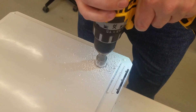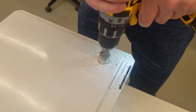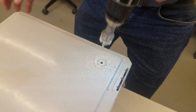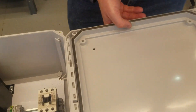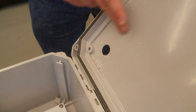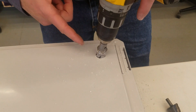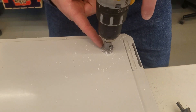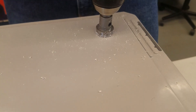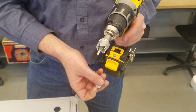Don't run the cutter fast enough to build up heat. The faster you run it, the more heat it will build and the sooner it will dull. Now if this were a steel panel we would continue through, but fiberglass is bad about splintering as the cutter breaks through. To prevent this, stop drilling, open up the door, and begin drilling on the inside to finish cutting from there. This way you have a sharp edge on both sides. Once it breaks through, there's a flange that prevents it from going all the way into the panel and damaging internal components. The spring pushes the slug off the cutter so it's ready to drill the next hole.